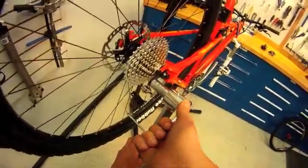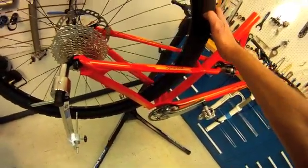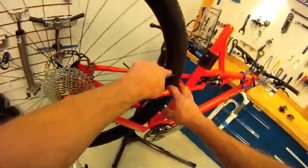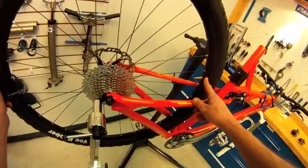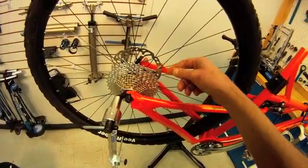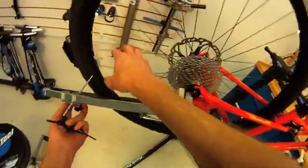This secures into the hanger, and we have a gauge that we'll slide back and forth. Our wheel, which is good to keep spinning — if you recall, we have our fluid in there. We will check always at one point. If we check always at one point, it's not going to matter if the wheel is exactly true; that one point will always keep a reference point. What we're truly trying to do is get the hanger square to the cogs — extending that plane, extending this last cog, the 36-tooth, outward to the rim. So we're going to check starting at the bottom here.